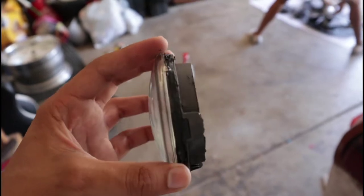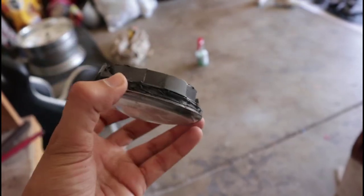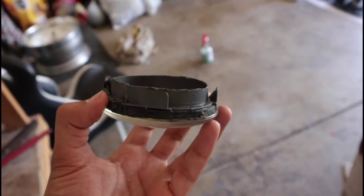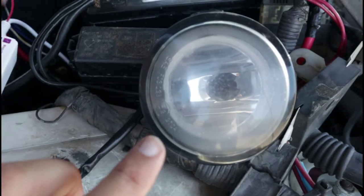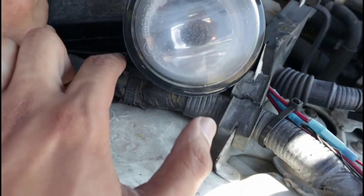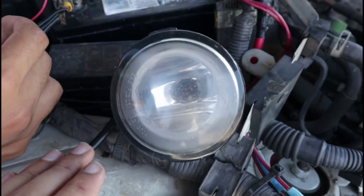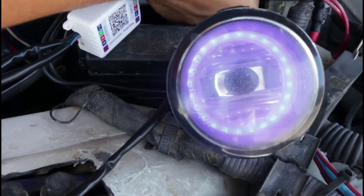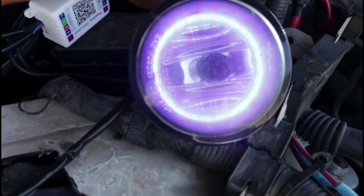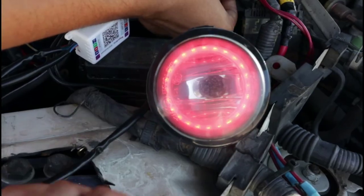The housing is trimmed down — not perfect, but it's kind of hard to make it exact with the Dremel. For the most part it should be even enough that the halo can sit in there nice and neat. Got the halo in there. To run the wires through we drilled a hole on the very bottom of the housing for the plug to fit through, put the halo in, pushed it down together — we're just testing it right now and we are all good. The halo looks really good!